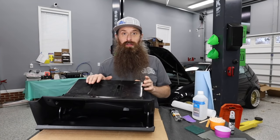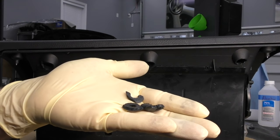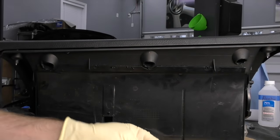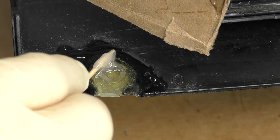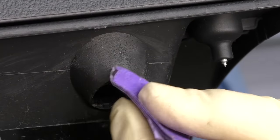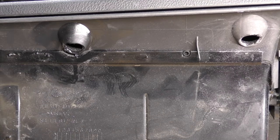While our instrument clusters are curing, I wanted to take a crack at fixing that super floppy glove box. Two of the screw holes are actually fine, so we don't need to worry about those. On the top ones, I actually found most of the pieces that broke off, so we can place them back and reinforce and epoxy the whole thing. On the bottom one, we won't be able to do that, so we'll have to do something similar to our clusters and make a tab. Just like the instrument cluster repair, our process is pretty much the same — we'll scuff each section up really well with sandpaper, then go back and clean with rubbing alcohol, doing one at a time so we don't have to clean it a second time.